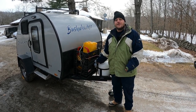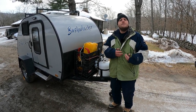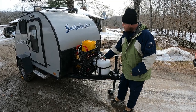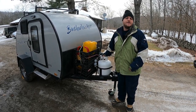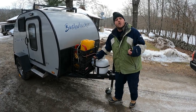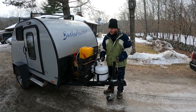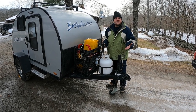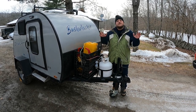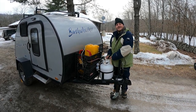The first tip I have for you is that there's a safety device in the regulator. It will trip and shut the propane off if it senses sudden bursts of propane coming out of the tank — obviously to prevent catastrophic gas leaks. Sometimes though, we trigger it when we open the tank too quickly or when the gas in the tank expands suddenly. So if you're having propane trouble, shut your tank off, disconnect the line from the tank to the regulator, let it sit for a minute or two, reattach it, and open the tank up slowly. This little tip has saved a lot of people on camping trips and can help you avoid bringing your camper in for service.